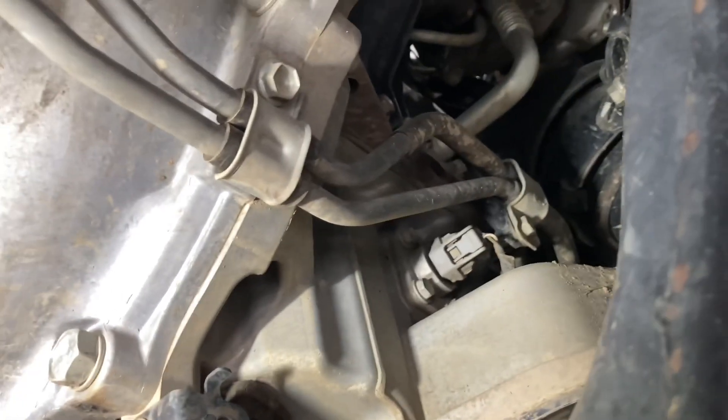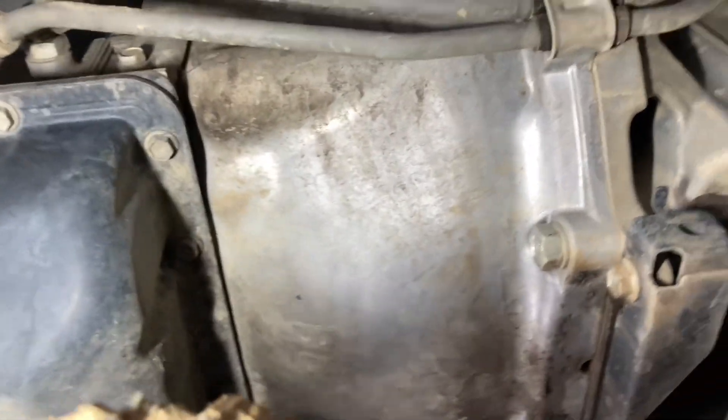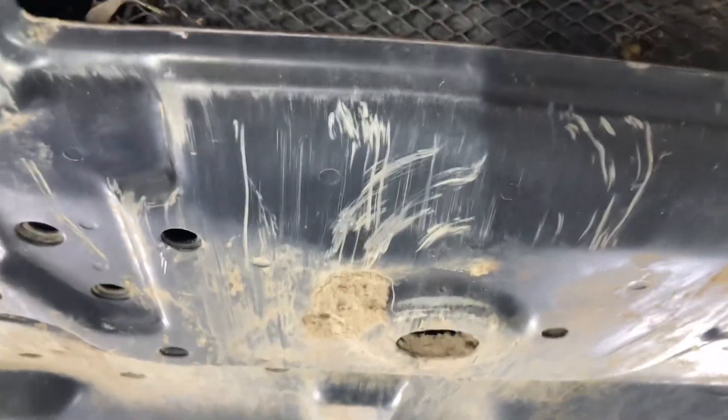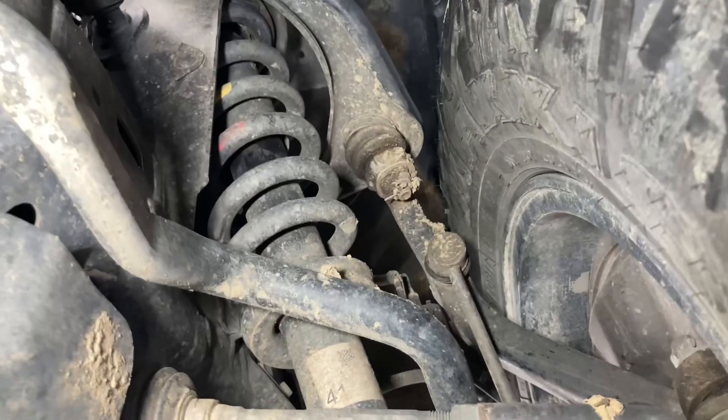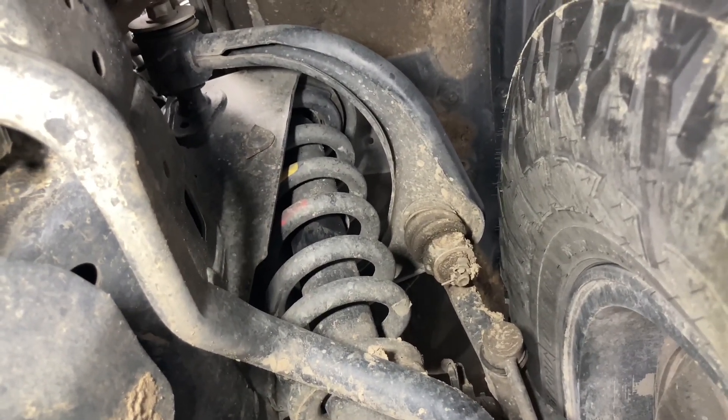Be aware when you wash the vehicle you need to wash those rocks off. When you turn full lock you can spit mud towards the transmission, and it lands on that cover. Also, this vehicle hasn't got a lift - you need to get a two-inch lift. When you hit the tracks without clearance, using standard bash plates, you're going to hit and damage things. At Fraser Island with oil and sand, the scraping pushes debris up there as well. The bushes are actually starting to split already - that's what you get bouncing around on Fraser Island sand dunes.